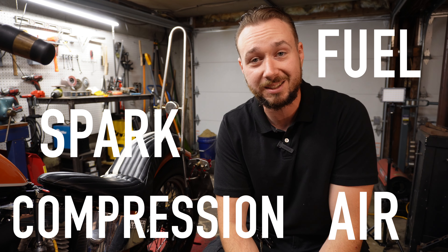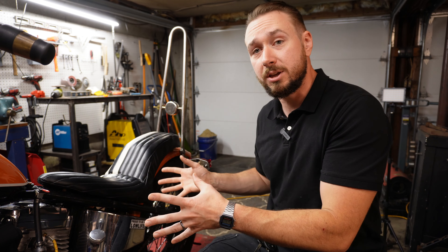However, most videos on this topic tend to forget the key fifth element to this equation, and that is you. More specifically, what did you do? Were you recently working on your bike? Did you just put on a new coil? Did you just change the charging system? Did you just mess with your ignition? Because most times when a motorcycle won't start, it is your fault. I'm not trying to say it's your fault and I've never done this — I have caused many a problem on this bike right here. Before you even get into the fuel, spark, air, and compression that we're going to talk about today, ask yourself that question: what is the last thing you touched on the bike? Because there's a good chance that it is one of these four, but you could dial that down a lot quicker by asking yourself what you touched most recently.